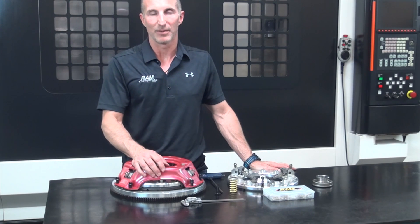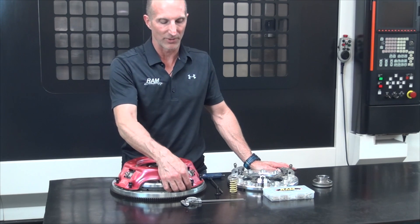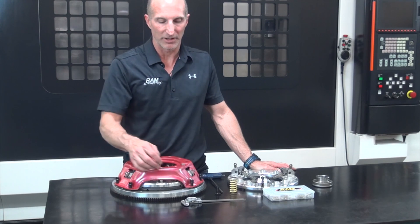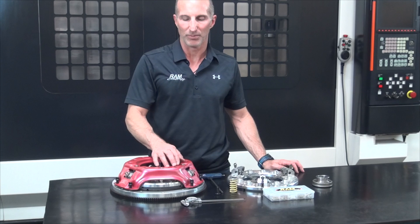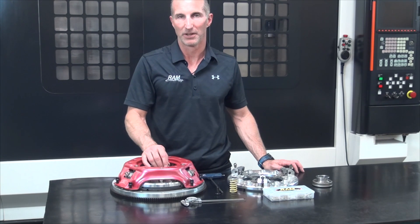As the clutch is run, that number is going to increase to 1.960", 1.970" as the clutch disc wears and the mating surface wears a little bit. To adjust for that, we'll use the wear shims underneath the hat when you're servicing the clutch to bring that ring height back down to 1.950". By returning the cover assembly back to that original height of 1.950", you're maintaining the spring pressure and the lever angle or position so the clutch will respond and react to your adjustments.